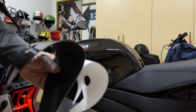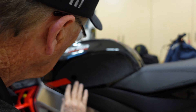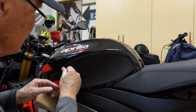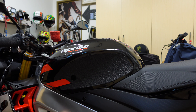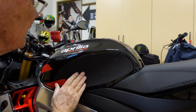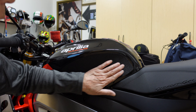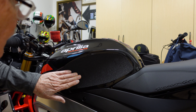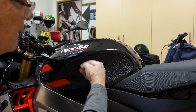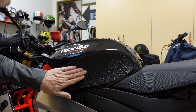So we're going to wipe down this side first and get this installed. Let me bring you around to show you the very nice looking red flashing along the side of the bike — this grip is just cut out to match it. Alcohol prep pad work done; I'm going to let that dry off a little bit. Then I'm going to start the application at the top and work my way forward. There's no science to this really — just taking a little time and being careful. I've got the paper started to be peeled back from the tank grip, and that's going to allow me to start.